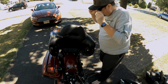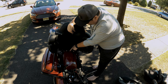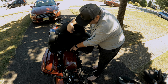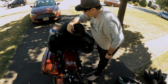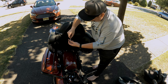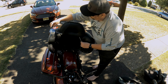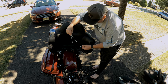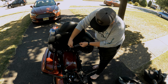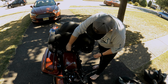If you have a Harley you're going to know what you're looking at - this is the hole where the screw and bolt would normally sit. What I'm going to do to fix this issue and make it super simple is I'm going to take the nut, slide it onto a zip tie, and then run two zip ties - these are eight-inch zip ties - through the hole. Because of the way they're shaped, they're going to come out the left side of the wheel well. So I'm going to push these down in the hole.